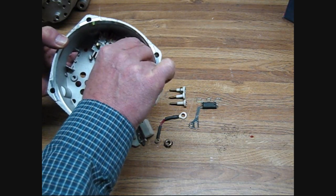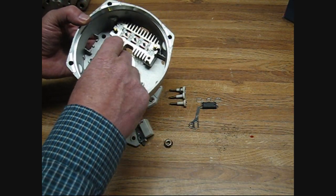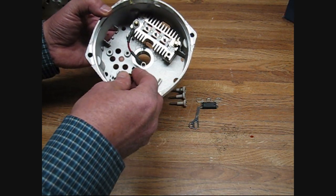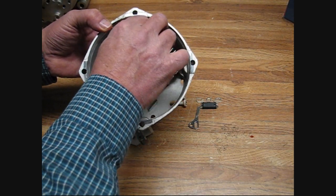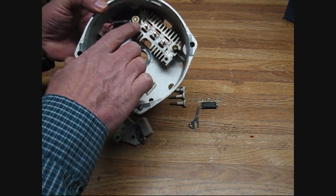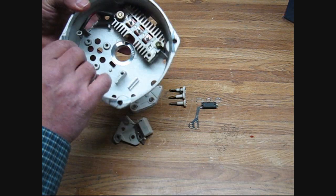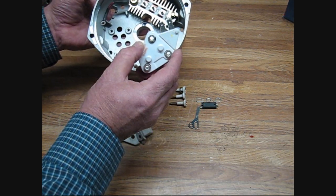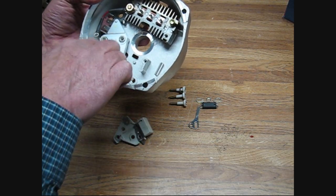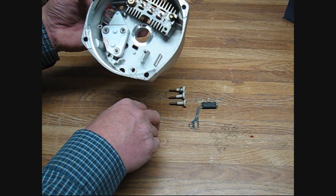This ground screw is going to align into this hole on this side. Then take your jumper wire — first you're going to put that on what would normally be your positive battery post, but because you're going from negative ground to positive ground, this is now going to be a ground post. This would normally be your positive battery stud, but on a positive ground system this now becomes a ground. It's really important that this six-volt voltage regulator is still negative ground, even though we're putting it into a positive ground system — it's going to work still negative ground. The bridge rectifier is what really makes a positive ground alternator positive.